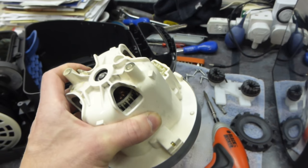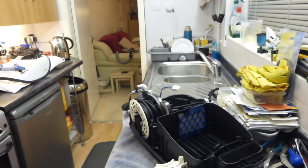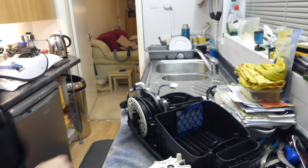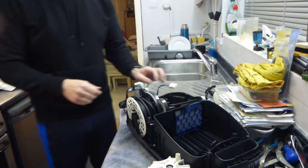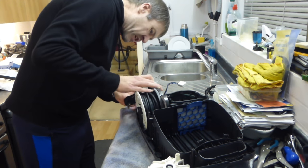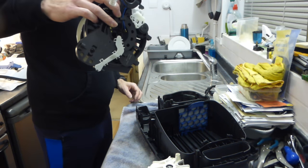That's how easy it is to get to the motor — it really wasn't difficult. If you took another machine apart and took the motor out, you could swap them over just like that. Now if we wanted to take out the cord reel — sometimes they're clicked in, sometimes they just lift straight out, and this one just lifts straight out.